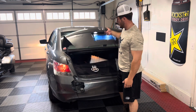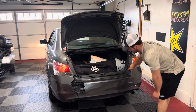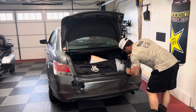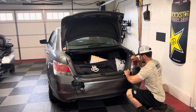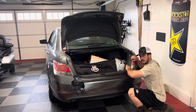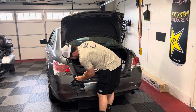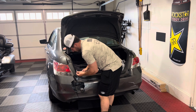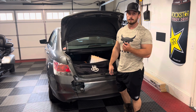You're going to want to pop the trunk. Down in here there should be two plastic covers — one of them is missing — you're going to want to pop those out with something like a flathead screwdriver, and then take a 10 millimeter socket and remove these two bolts. Set them off to the side because you will reuse them later. Also set the tabs to the side with the bolts you just took out.